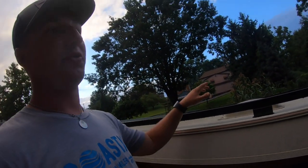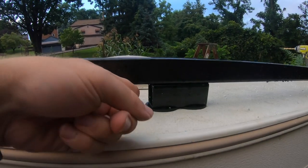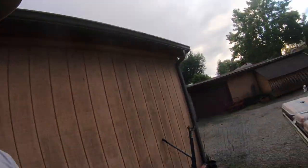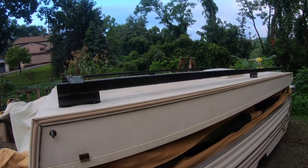When you do this roof rack, most of these struts that you buy are galvanized. They will not rust. I painted them at the ends where they are cut, however, they will rust. So at the end of each piece of strut, like there and there, they will rust there if they've been cut because it's not galvanized. That's just exposed steel. But the rest of it, like this main body of it, shouldn't rust. But I think it looks better painted, so I painted it.